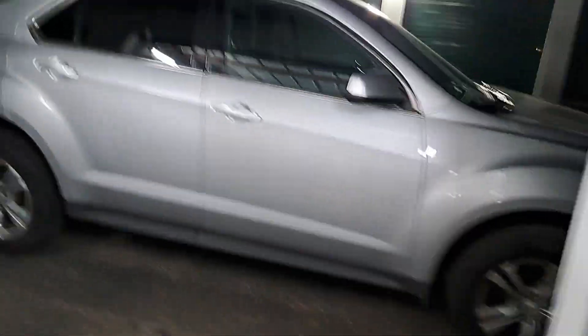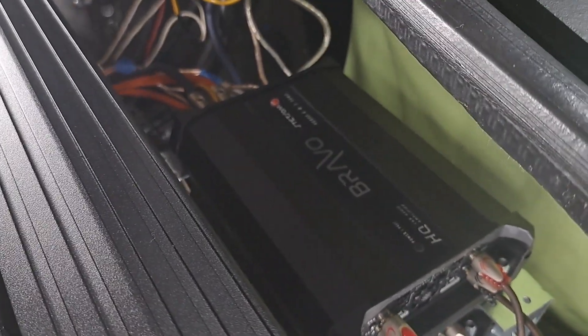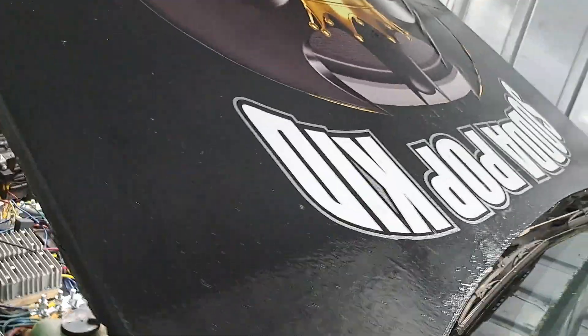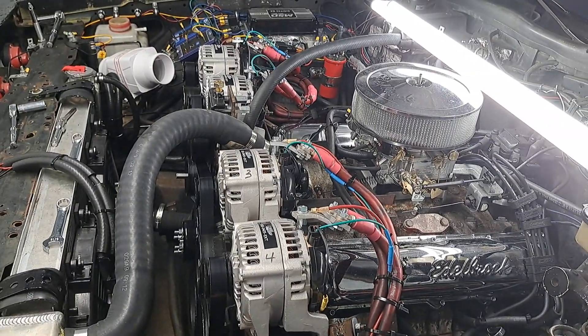Since I got the lights on here, everything's working pretty good — no noise or nothing. These little Bravos scream, bro, they scream. And they're 17-volt capable, which is another reason why I wanted them. So now I can turn my voltage up into the 16s — like 16.2 or something — because those little amps can handle just as many volts as the big ones.